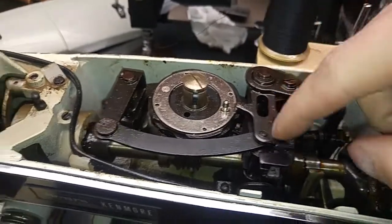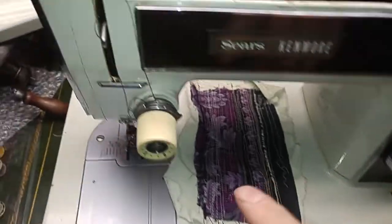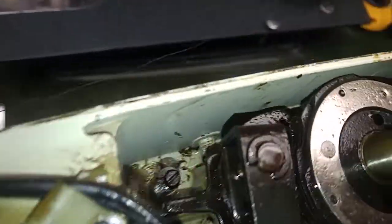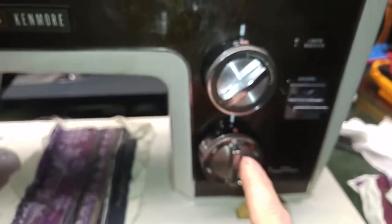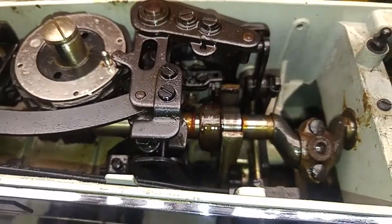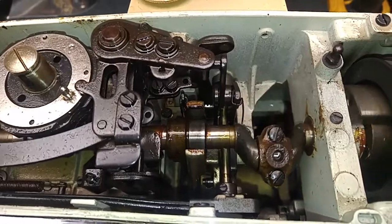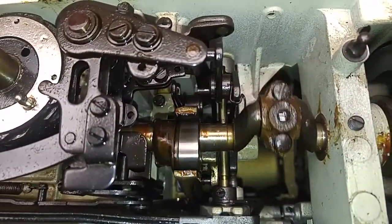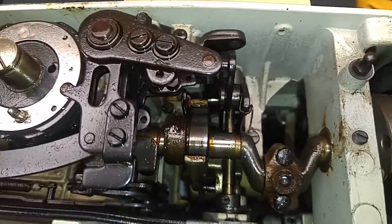It's going to look over here at this lever, and this is where I suspect the issue is going to happen once I get the timing on my machine. There's a cam over here, and that finger follows a cam that's underneath this cam stack that's related to triggering the reverse. So now on the S setting, that would be a white stitch that's going to trigger reverse. You can see as I rotate, all of a sudden you see that reverse mechanism move.